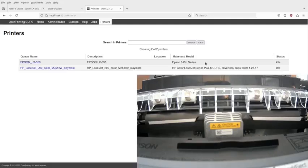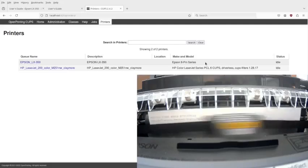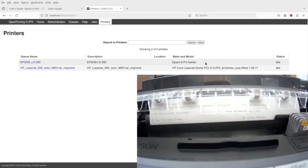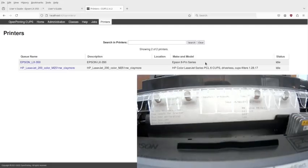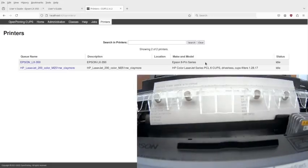So we're going to go into the menu. English. I think we're going to just go straight down into item and see if that lets me start to see the individual items. Oh, yeah, that's much better. So now I can just go through the items. Auto tear off. I wonder if I changed the font, it would have used a darker font here. Anyway. Line, print direction, software. Oh, that was it, software. Yeah, so we hit set. There, it's now back to EPSON 9-pin printer. So let's store that.